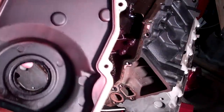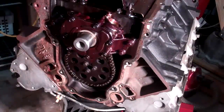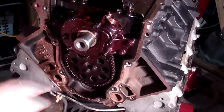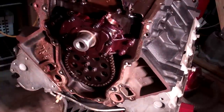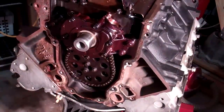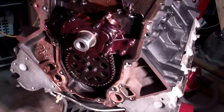There you have it. Right there — this is the timing chain, oil pump. Alright guys, I lined up the two cam dots. You probably can't see it, but there's one here — the cam dot and the crank dot — lining them up now. So that stays there. I'm not taking off the oil pump, not changing anything there, not really going to mess with that.